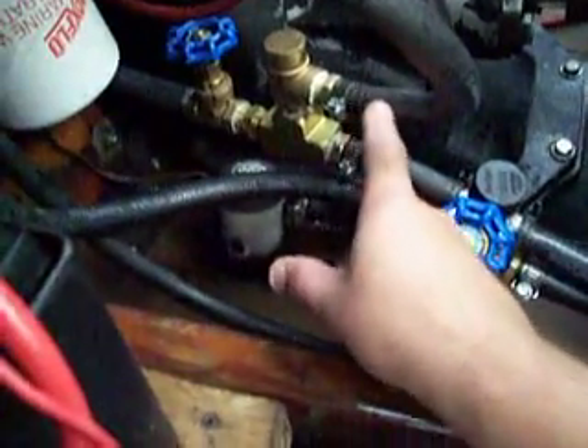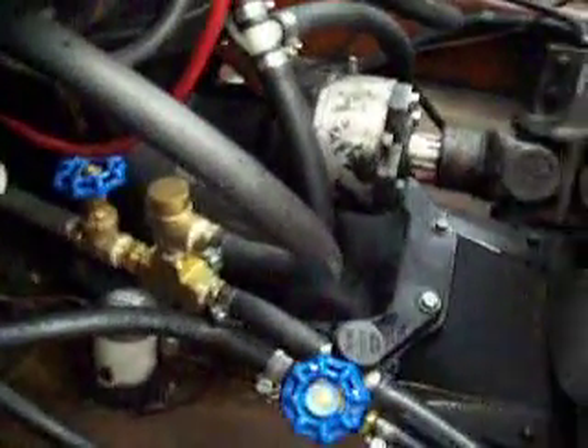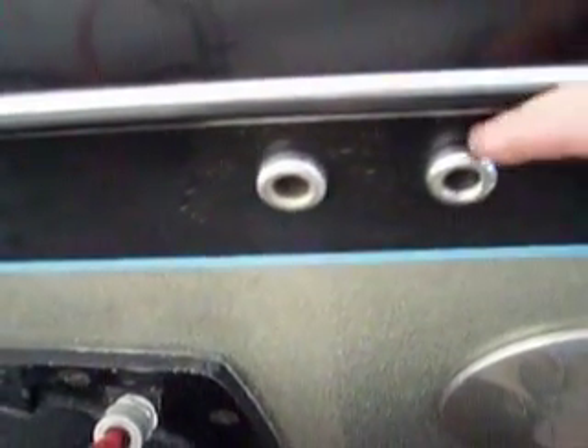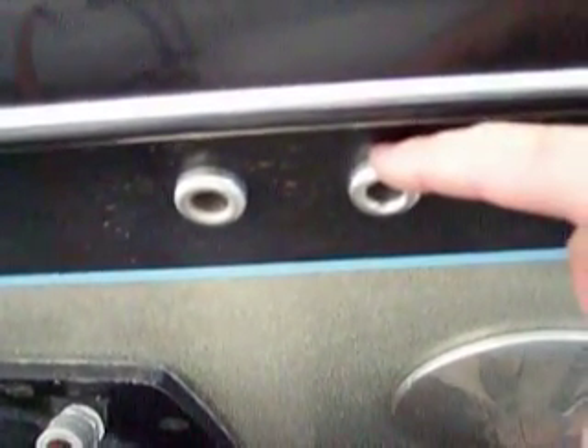This fitting here is half inch. Our complete kit comes with a spill valve connector, which is just a connector that goes to the back of your engine. On my own personal boat, I spent the extra money and bought a nice chrome spill valve — these are the spill valves. This one's for my exhaust system because I have headers, and this one would be for the relief valve. We've included a simple plastic half inch spill, but if you want to go fancy and get chrome, you can buy one from Dana Marine, Rex Mar, or some of the other jet boat shops through the internet. We're trying to keep our costs down and just give you what you need to get going.